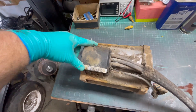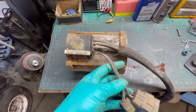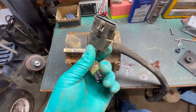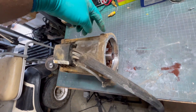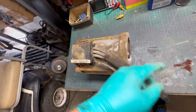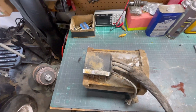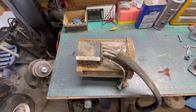Just a quick tip. To disassemble the motor, we're going to take these two torx screws out and get this cover off. Here's our encoder bearing harness and the temperature sensor. Then we've got four big long allen head bolts that come out and the motor just comes apart. We'll show you the encoder bearing inside once we get it apart.